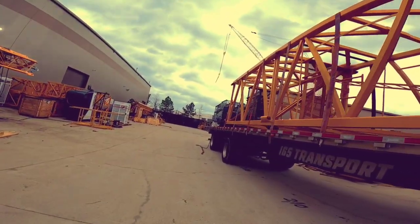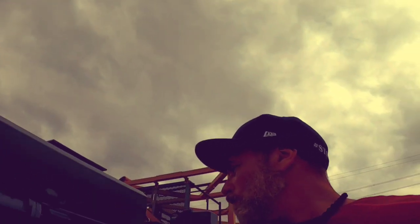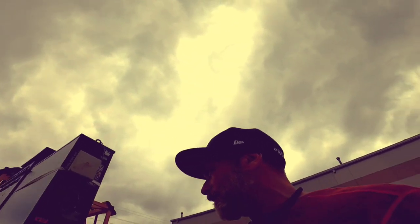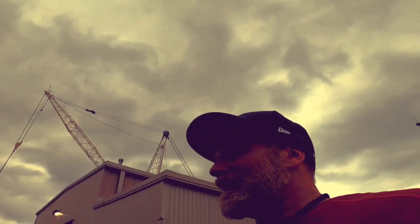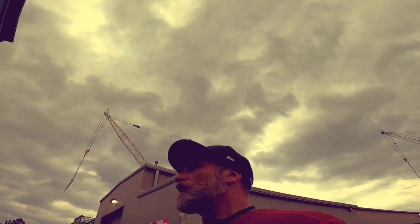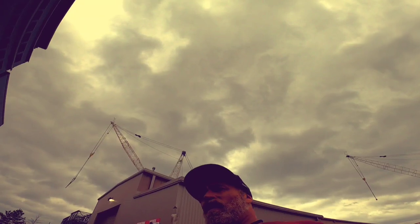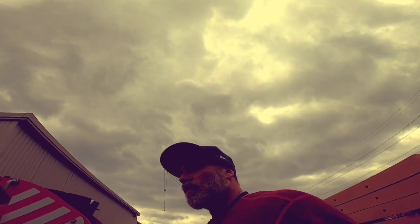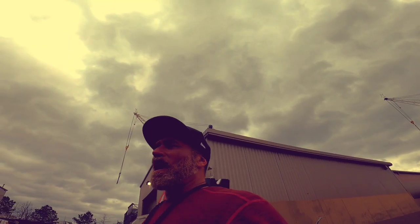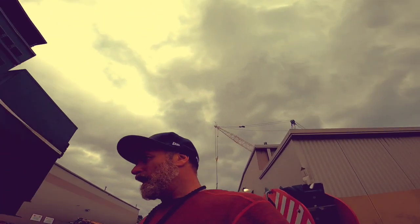It's about to rain, so we want to wrap this up. We're gonna get these chains in here. I felt like this was an ideal opportunity to show some of the new guys what you will have to do with your chains sometimes, because your hook isn't gonna fit through certain eye holes, and there will be places that you will go where they have the air compressors and stuff like that wrapped, and they will tell you you can only hook through those holes. So you can't say, oh, well, I'll hook my hook over here. In some places, you'll have to pass your chain through the tow holes, eyelets, or tow points, whatever you want to call it, that they require you to pass your chains through.